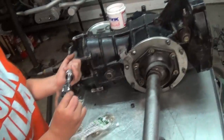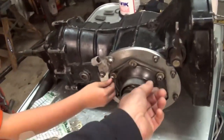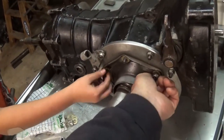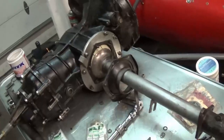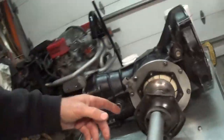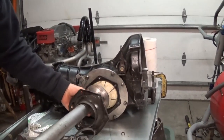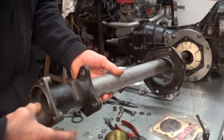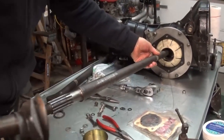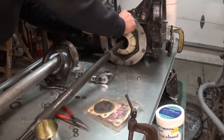Okay, so let the nut come off. There you go. When they get loose you can take them off the rest of the way with your fingers. See, they got washers underneath — here's one over here. You hold the camera. Watch my hands. We're gonna pick this axle up — we don't want to pull the axle out, we want to get this cover off so we can get all but one of these gaskets.